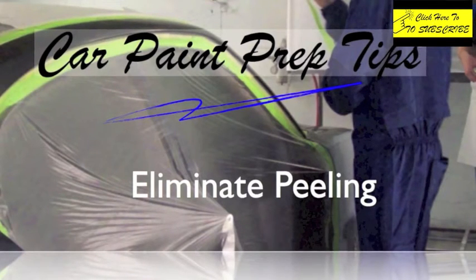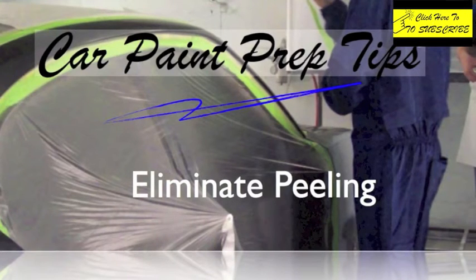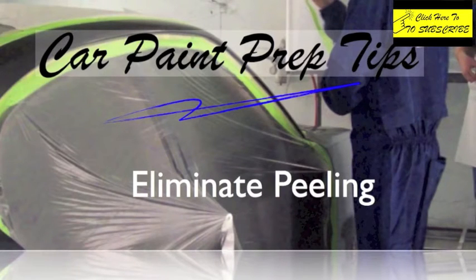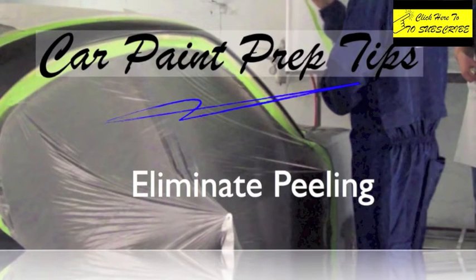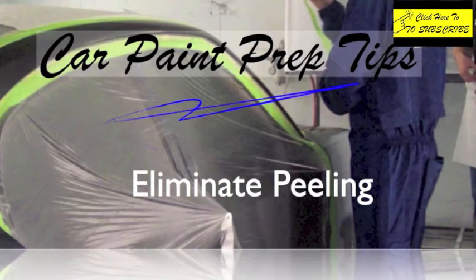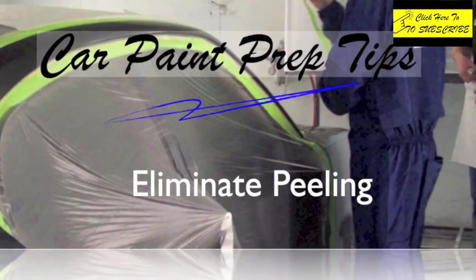An easy way to tell if an area is sanded well is if it looks dull, because when you sand something, it gives it a dull appearance. If you clean your car off and you see a real glossy spot or a glossy edge, you need to go back and hit that area either with the 400 to 600 grit sandpaper or with a scuff pad. Or if you're clear coating, you'd want to use a finer grit, depending on what you're doing to that area. But try to make sure there are no glossy areas left, and that will ensure that you're going to get proper adhesion.